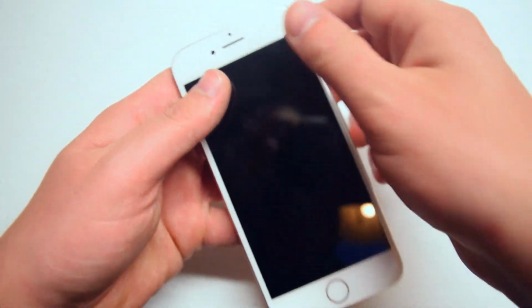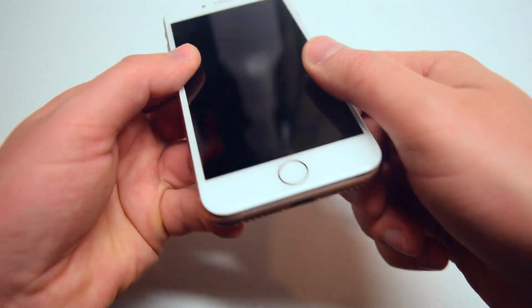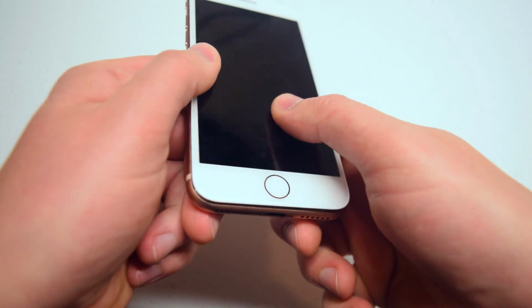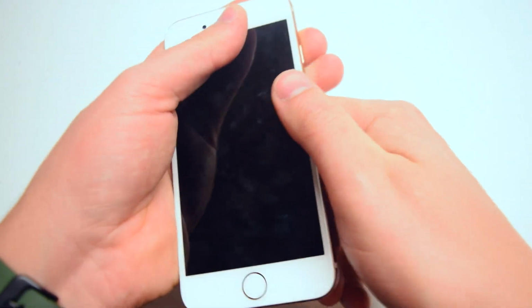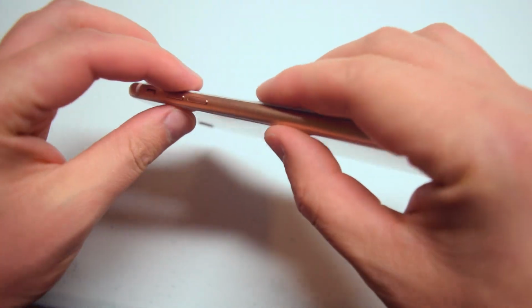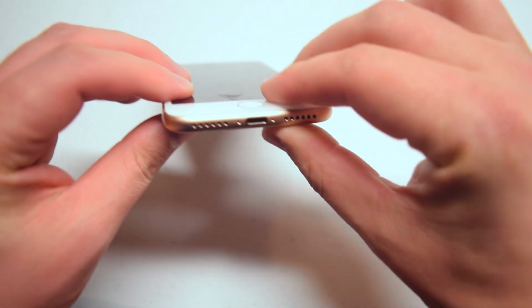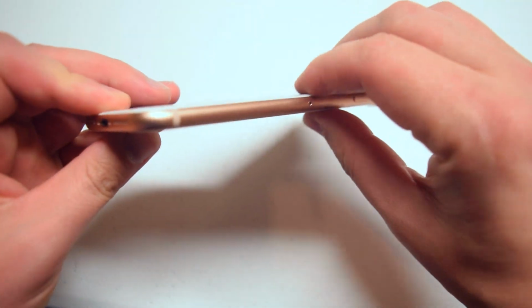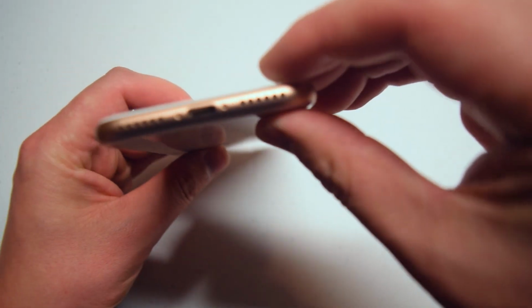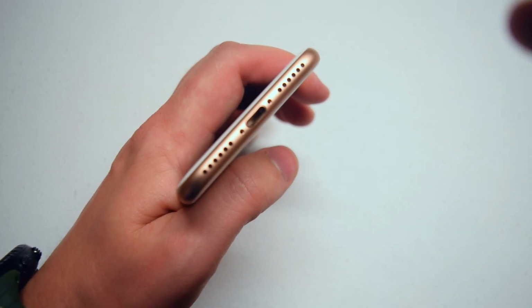Clamping it up is very easy. Just close it up like a book and then apply pressure on both sides simultaneously, and just keep going around and pushing it in ever so slightly, and it should start clicking right in. Then go around the contour, clicking in and mashing in the rest of the gap. So just go around a couple of times, make sure it's nice and firm.